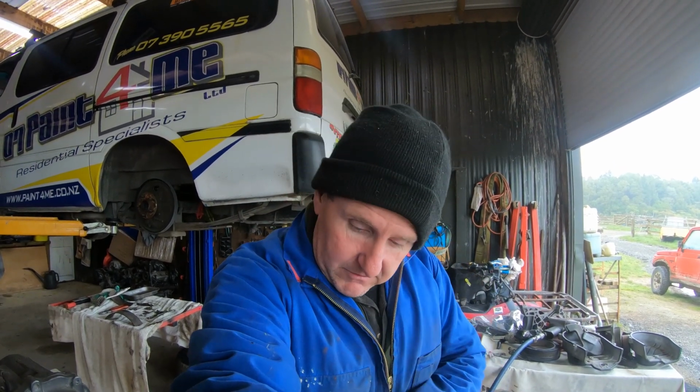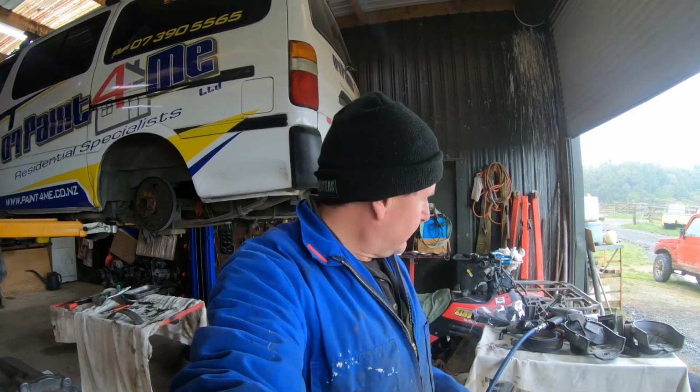Now I had some of these where they've been timed up wrong in the scissor gear. Set up like a Nissan where they both go the same way. If you understand Nissans, two pulleys on the front. It's going to rain and make it loud. And it didn't do damage. I've had one that dropped that grommet. Someone didn't know what they were doing. The grommet had gone down the front. It had been bouncing around. That one didn't do damage. Luckily, I thought it was. These are an interference engine.